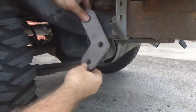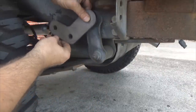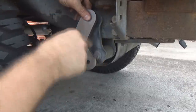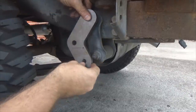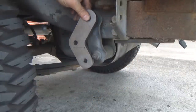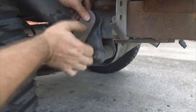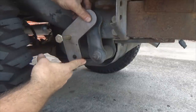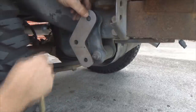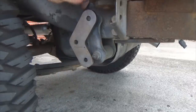So to recap the rear: long leg high with the arrow pointing toward the front of the Jeep — you get good travel backward for articulation, and coming forward the brace hits the frame to prevent bending your leaf. Long leg high, arrow pointing forward — that is the proper mounting for boom shackles in the back of a YJ. If you liked that video, hit me with a thumbs up, subscribe, and cool comments are always welcome.